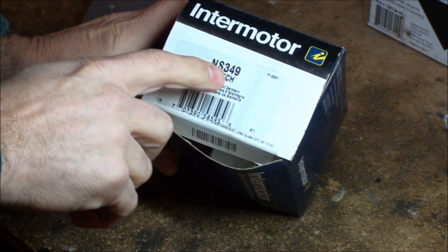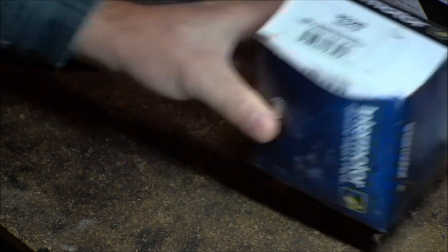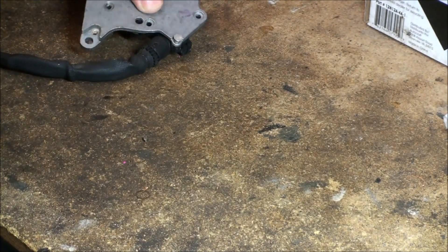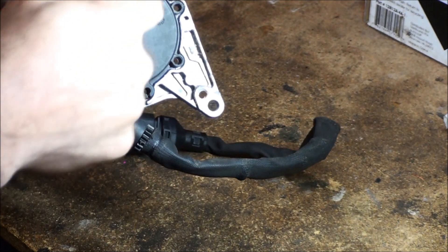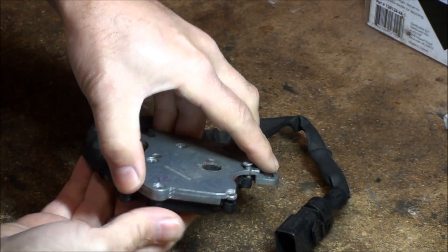What I did was drill the back of the rivets out. You could possibly fix this thing, though I don't know if all that labor to get to it would be worth it — I think you're better off just replacing it. Let me start by saying this was the part I used: Intermotor NS349. I labeled it as a switch — pretty expensive piece. Like I said, I drilled out the two aluminum rivets on the back. They were pretty easy to drill out and then the thing just came apart.